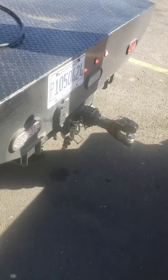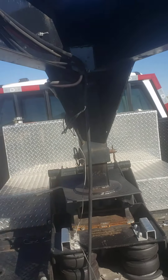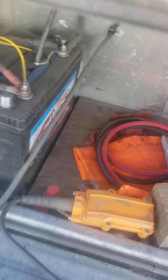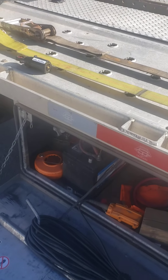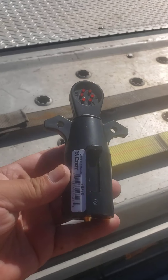Somewhere we got 12 volt to there, so we got 12 volt up. So we got 12 volt up, down. Somewhere in there, 12 volt doesn't work — or in there, or the other junction box. That's right about here I think — I'm losing 12 volt. But I would have just thought it was the truck, and I had this handy dandy little deal. So that's that.